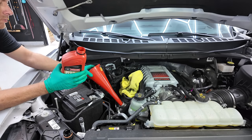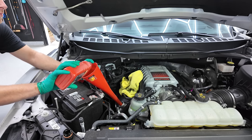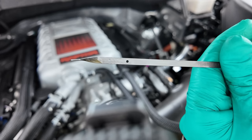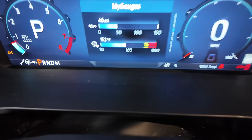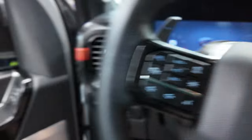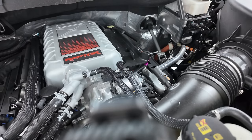After freeing up the oil filter with some tools, it's best to unscrew it by hand. I'm reaching up through the access hole on the skid plate, but be careful — there is oil that's going to drip out of the skid plate in this little square right here. This engine takes a lot of oil. The owner's manual calls for 11 and a half quarts of Motorcraft 5W50. I started off by putting in 11 quarts before adding another half a quart and checking my oil level along the way. Once I was comfortable with the amount of oil in there, I ran the truck and looked for leaks, made sure that the oil pressure was sufficient before topping off again to meet the standard oil level.